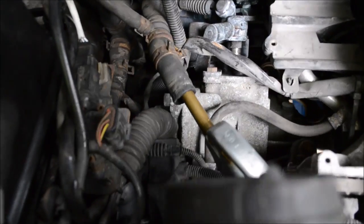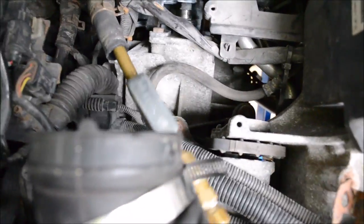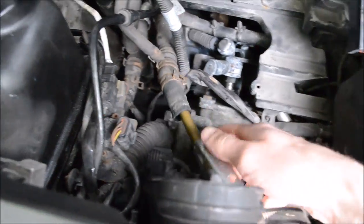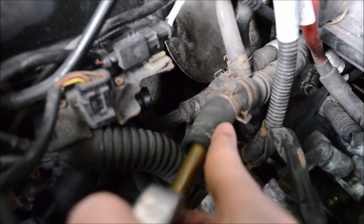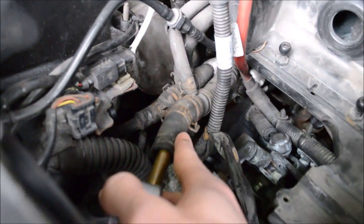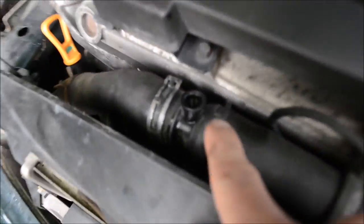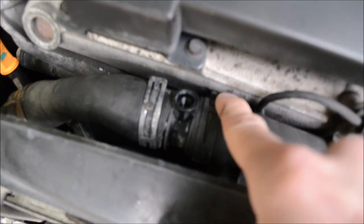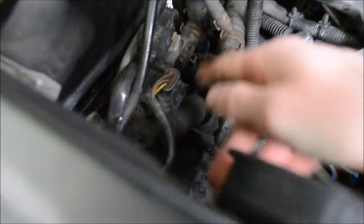And if you think you haven't gotten all of your coolant out, you can use some compressed air. Shoot it into this line. Don't use over 16 PSI. Make sure your cap is closed. You can also compress it from here and make sure all your other lines are on. Of course, leave that one off.